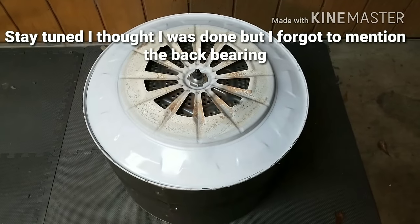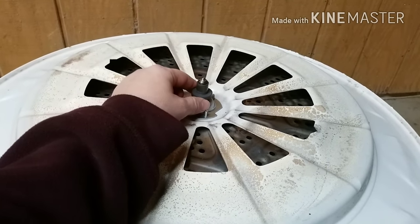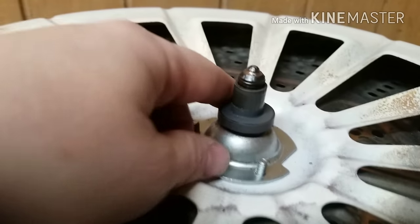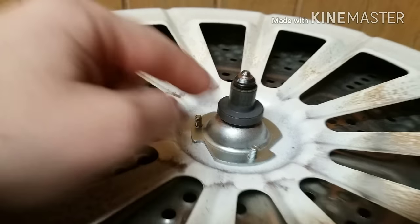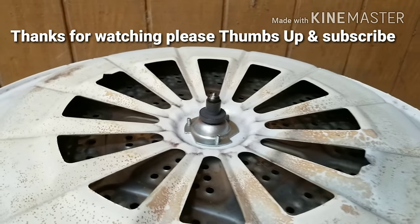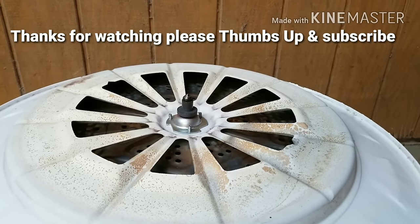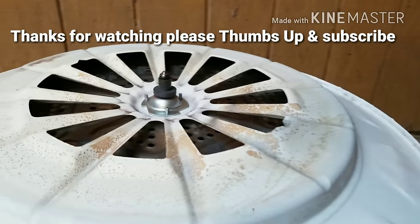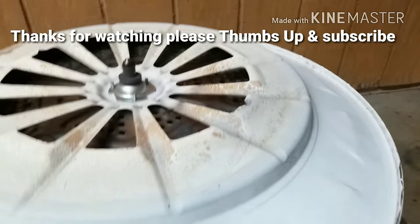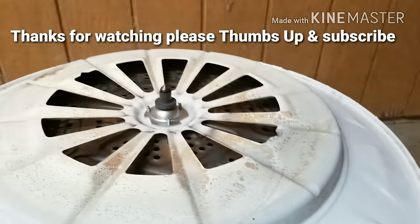One quick note: this is the back of the drum. If you take it off, this is the rear bearing — very rarely have I ever seen them messed up. You can see it right there and it's fine. I think I've replaced one over the last couple of years, and I've fixed hundreds of dryers. But just so you know, there's also a rear bearing that could go out. You may want to take the drum out if it's still making noise to check if it's the rear bearing, but it's very unlikely. There are just three screws — go from the inside of the drum, undo those three screws, and you can buy the whole thing as a kit.